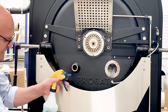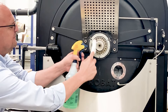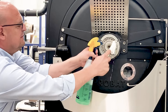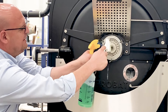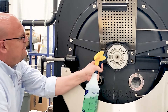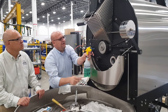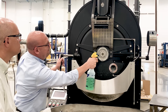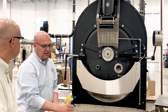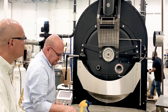You kind of want it like that. Remember, this is good grease — we can say that. So you start scrubbing and spraying. Look at how the ball bearing starts to clear up. This is how you clean the bearing. It definitely looks a lot cleaner. When you do this, you keep turning the drum and keep cleaning. Now if you notice, it's not really falling out — there's a reason why. This is new grease, but if this were old grease, this thing would be oozing out. So all you've got to do is keep spraying a little bit more and keep scrubbing.